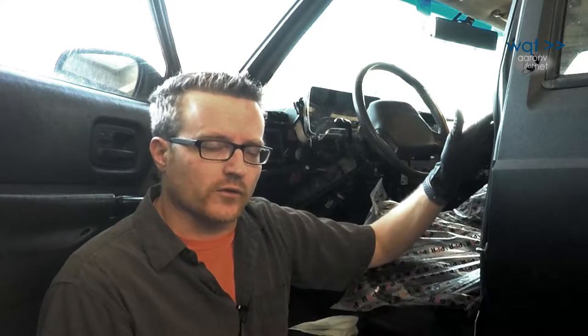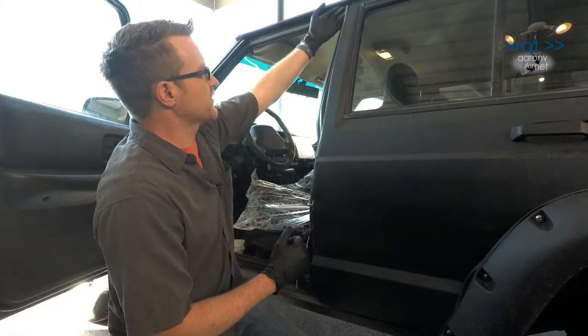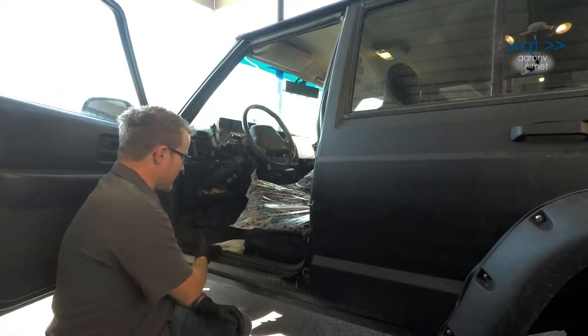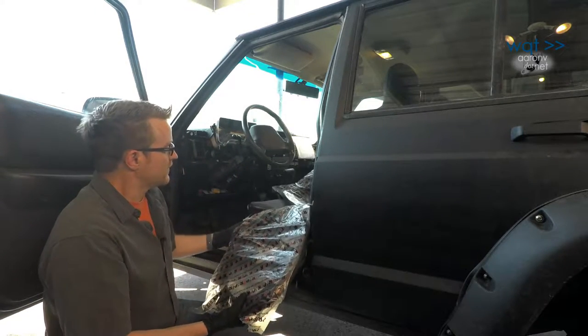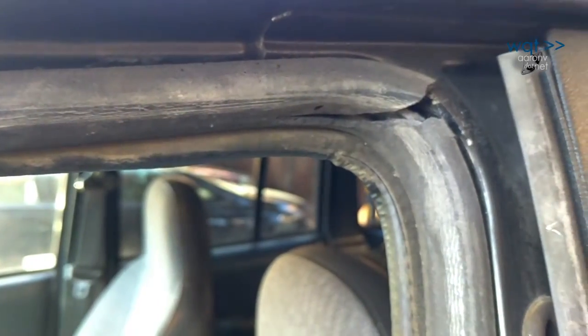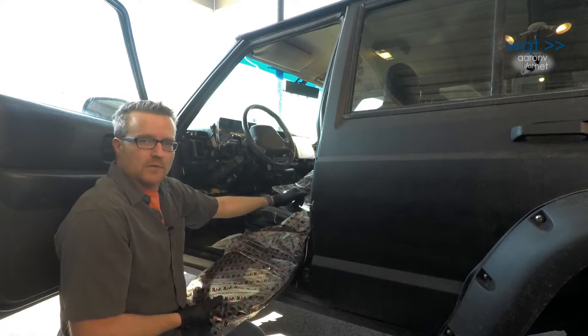You can go to a dealer for door seals, and in some cars you might have to, or for some parts of some cars. For example, we have a strip right here which is starting to give out — it looks like it might be custom. There's also a deflector piece along here. However, the main door seal around here happens to be one continuous piece of rubber with a split, and that means we can actually replace this with aftermarket. They weren't too pricey at all — about $40 a piece. So for each door, yes that's $160, but compared to having a vehicle that lets in excess wind noise and tires you while you drive, or when it begins letting moisture in which can actually ruin your vehicle, this is a very cheap fix for a very common problem on old vehicles.